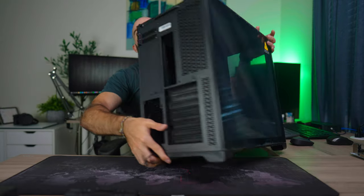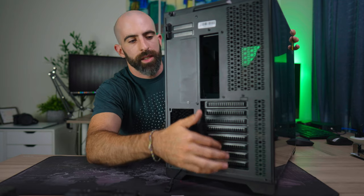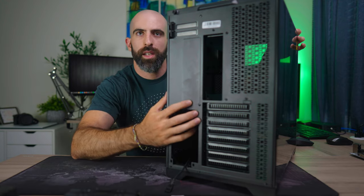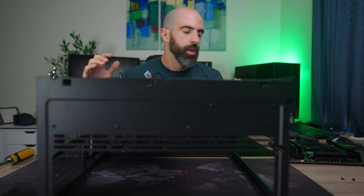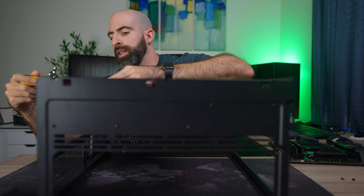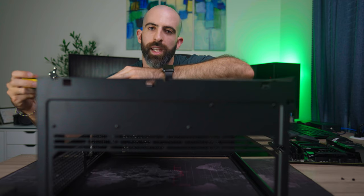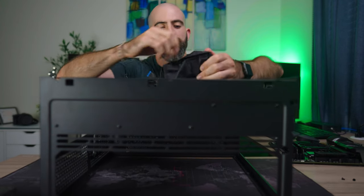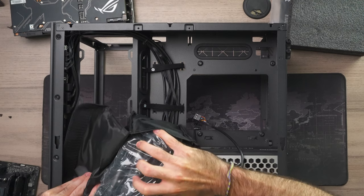All right, it's party time. Around the back you'll see this is pretty standard — what you'd expect out of a regular PC, but there's a cutout over here. My camera actually stopped recording, but luckily I didn't do much. I took the panels off and now I'm installing the power supply first, so we can route cables before the motherboard goes in — that way we don't have to reach around tight places to plug in that 8-pin CPU connector.